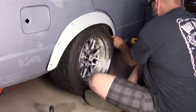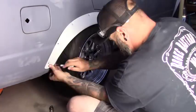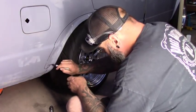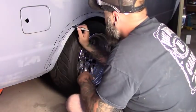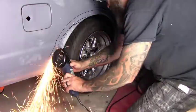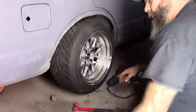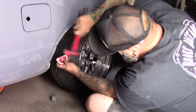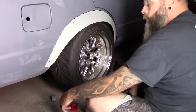Now the rears — the rears are a whole other beast, because this is a four-door and the wheel carries into the door well. So I'm simply going to line it up the best I can to deal with the door and deal with the excess behind. Same process: anchor it where I want it with self-tappers, trace it, and draw my line of where I'm going to cut. The front of the fender was actually really close and I did not want to cut any more metal away to lose strength. So I'm cutting from behind the fender, same way we did on the other, just cutting away the excess metal for clearance. This body line I needed to remove under it so it would sit flat. Lower it down, check our clearances — we're good.